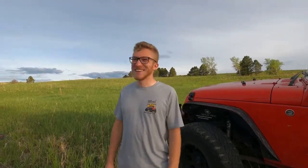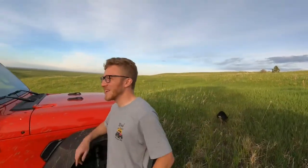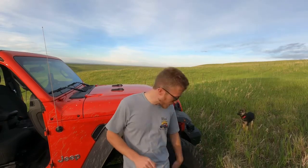I'm going to 4.88s - some might think that's too much gear for these tires, but it's perfect. A lot of people watching this channel will be on my side - 4.88s are perfect, especially if you're going to 40s in the future. On 37s I'm going to have gearing for days, but we drive down the highway to work every day and we don't go more than 80-90 mph. With the 8-speed automatic - which I love because even with the big tires it's been pretty good - with 4.88s this thing is gonna mob through the gears. So that's the plan for the front: Ultimate 44, 4.88s.